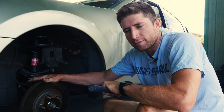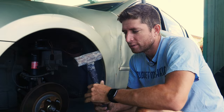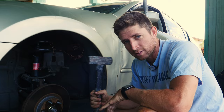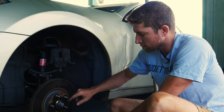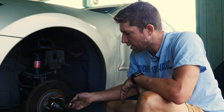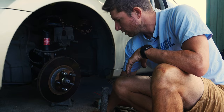There are a few methods I use to get a stuck rotor off. The most common and most effective I've found is with a hammer — not a small hammer. You need a sledgehammer; the bigger the better, at least a small sledgehammer to start with, and you'll have to hit it a lot less the bigger the hammer is. What we want to do is smack this rotor in between the studs, because that's our trouble area. We obviously don't want to hit the studs or lugs because that will damage the threads or start backing the lugs out of your hub. If you're not confident in your hammering abilities, you can just start the lug nuts on so that if you do accidentally bump one, it's not going to wreck your threads.